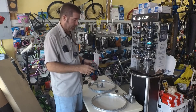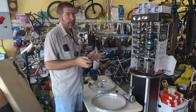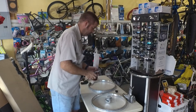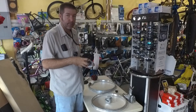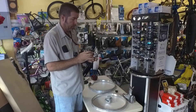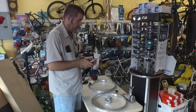This is the survivor — this is not going to be museum quality, this is just going to be a very nice survivor, and after we're done with this it's going to look great. The only real problem we've got is he cut the spokes out of the wheels before removing the freewheel, and the problem with that is now there's nothing to really grab onto. I can't put this into a vice because it would damage the hub further — there's still a decal on here that I don't want damaged.